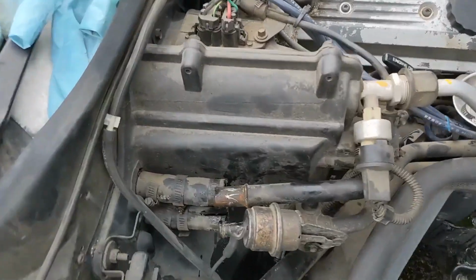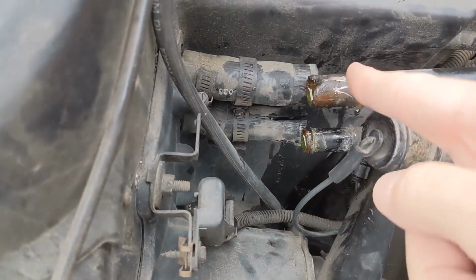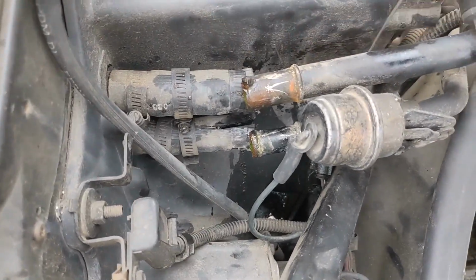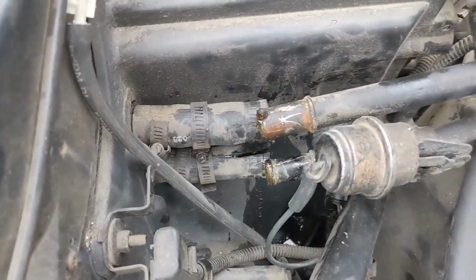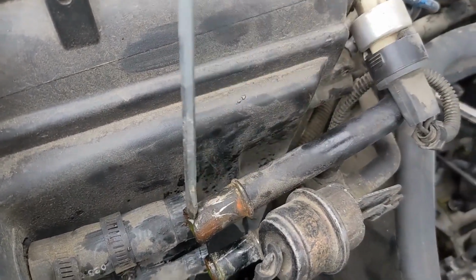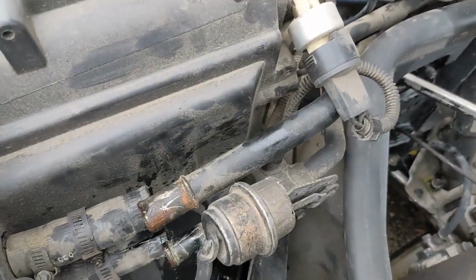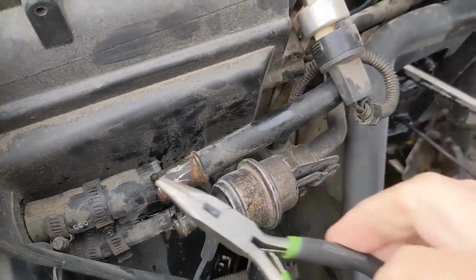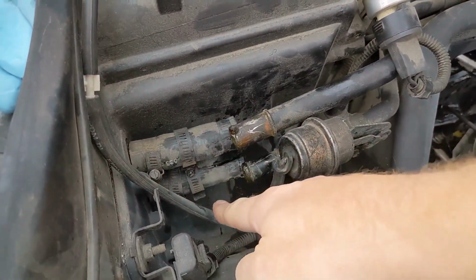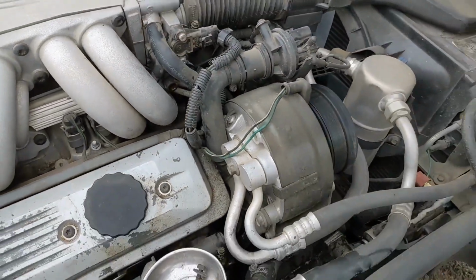Okay, so I got this disconnected. I sliced the bottom radiator hose and left the upper one. Well, I guess heater hose, it's not really for the radiator, because I didn't want to pull too hard and put too much pressure on this, because the other side of this is the heater core and I don't want to damage that. But I goofed that up a little bit, prying my screwdriver in there and trying to get the hose to come forward. So I'll just bend that back as best I can with some baby needle nose pliers. And then I'm just going to totally remove this bottom hose and have it just run the entire length to here on that inlet